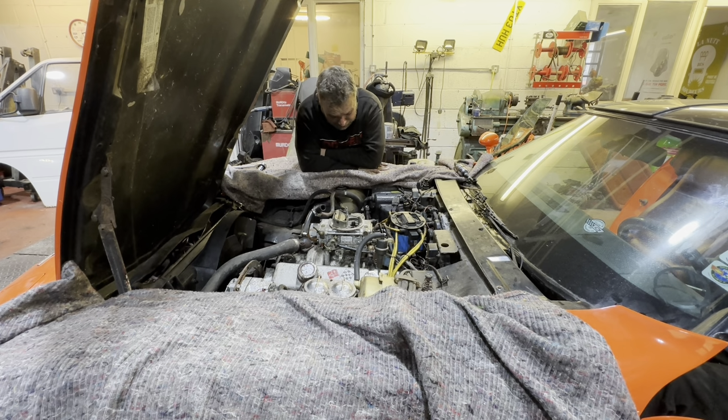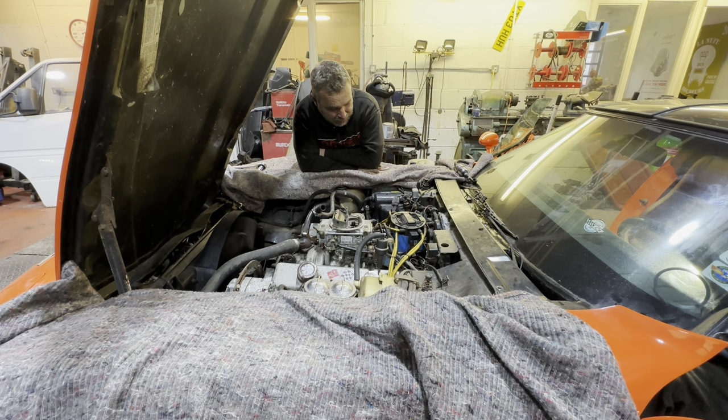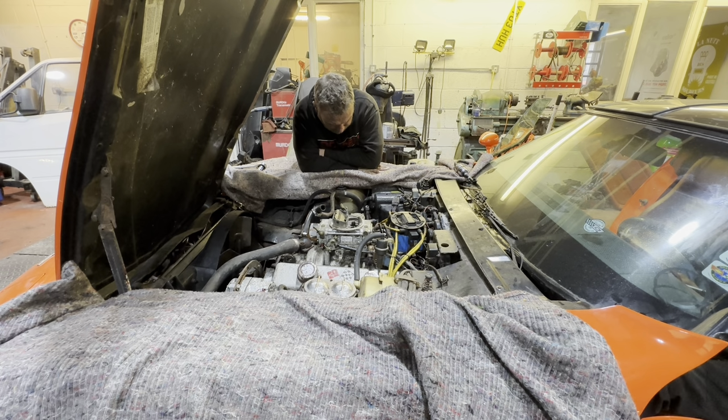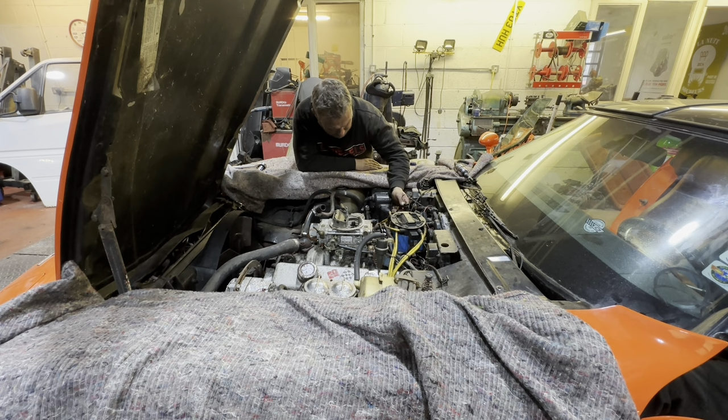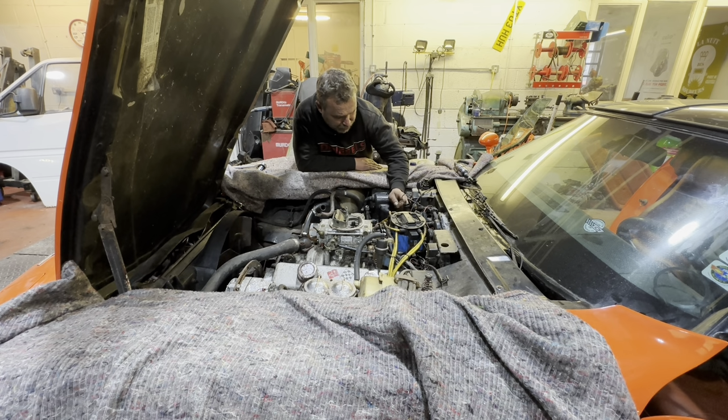What you might as well do, since you've done it already, is turn it over and see if there's any sign of the oil pressure gauge moving. Yep, it's a keyless mechanism. Oh, it's because it's worn out. Nothing. Do you want me to try again? So we've got no dash lights. I mean, the brake light comes on when I've got it in the start position. So no oil light. The gauge gave a little tweak, but that could be just... Oh, now the battery's gone off. The fan's just cut out on the front. I've lost battery power. Let me just try cranking. Nothing. All I did was touch this fuse here.